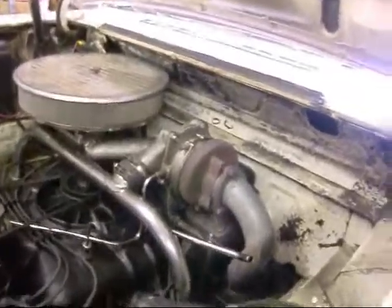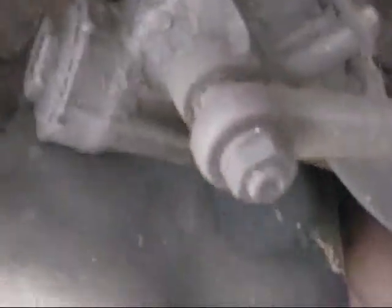I've got the front brakes adjusted with just a tiny bit of drag. Here's the play in the steering box — just a little bit. I'll take this apart one day, put a new bushing in, and show you how that's done. No rust up front, just surface rust. Hit a curb one day — no rust on the cross member. I saw a Corvair at a car show with the front cross member all rusted out. I'm missing one of my dog legs, but the suspension is all greased up.